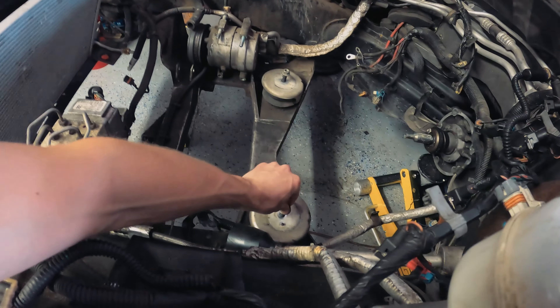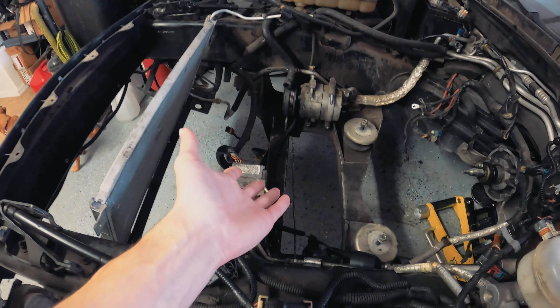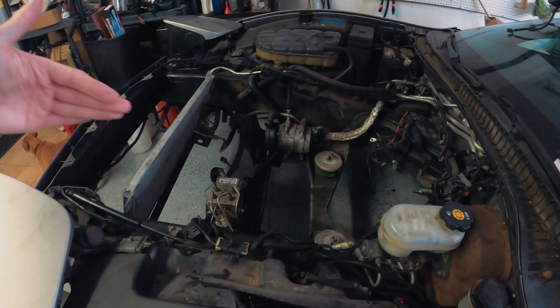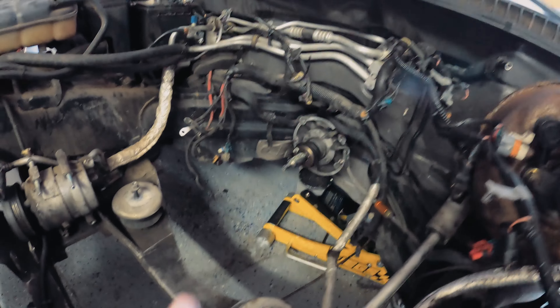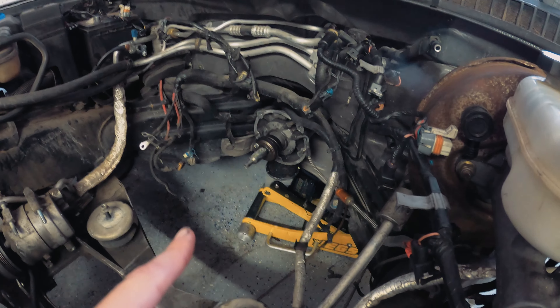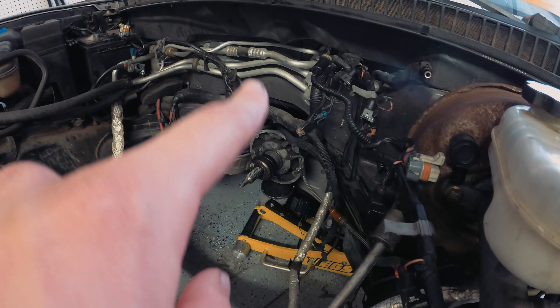You want to get your engine mounts in place — mine are loose so there's a little bit of wiggle room to get the engine mounted properly. My steering rack was already out, but if you're installing the damper and your steering rack is already in, it's not going to clear, so keep that in mind. You also want to make sure you have a jack or something underneath the torque tube and get that torque tube up as high as you possibly can, almost hitting the transmission tunnel.